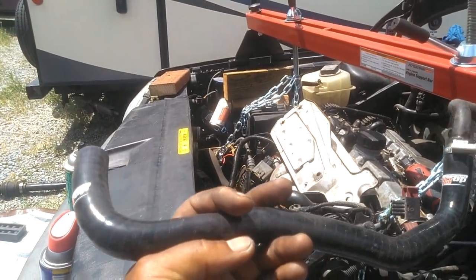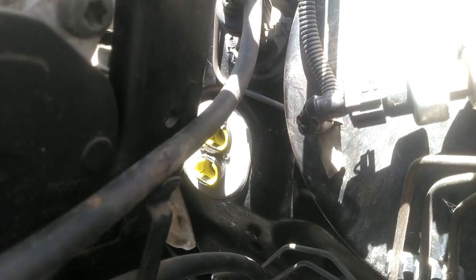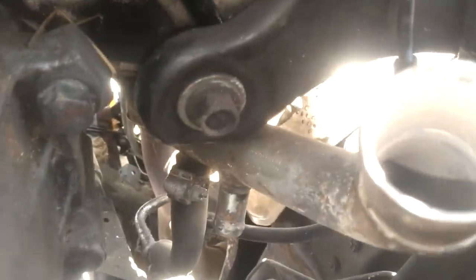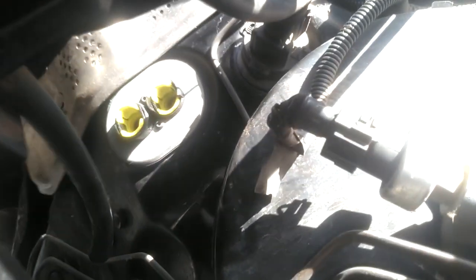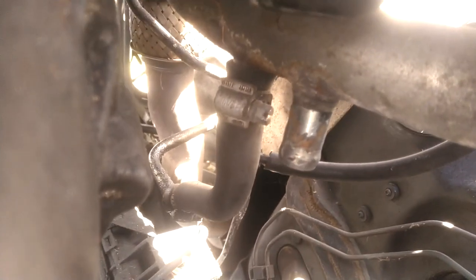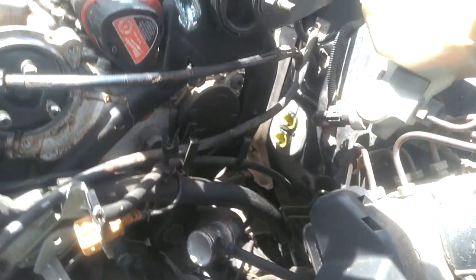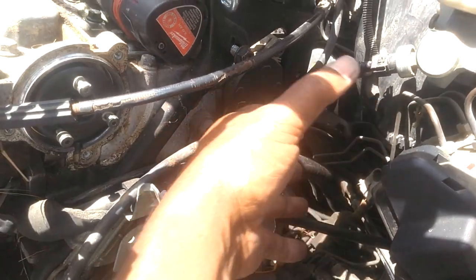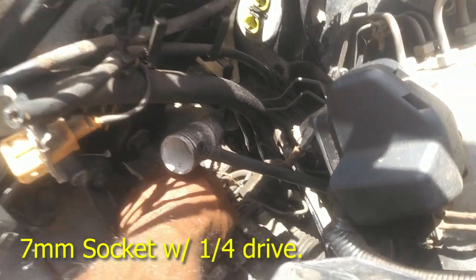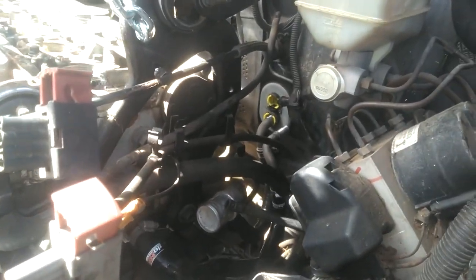Here's the upper heater hose — it plugs into the side of the engine right there, goes under the crossover pipe, and plugs into the firewall junction. This is the other hose; it plugs into this pipe right here in the middle and goes and plugs into the firewall junction. This other hose down there that plugs in next to it — you can see it's got a metal pipe on the end; that's the turbo supply cooling hose. If the clamp is orientated like that, you can often reach it from up top with a six-inch quarter-inch extension. You pull the turbo inlet hose, stick in a quarter-inch with a six-inch extension, run it under the pipe, and hit the clamp right there. So that's how you get those off and on. Got those heater hoses on and they are ready to plug into the firewall.